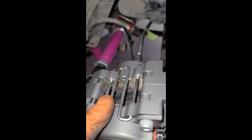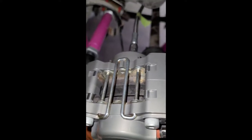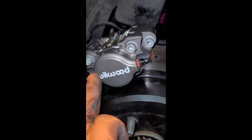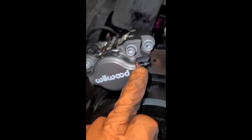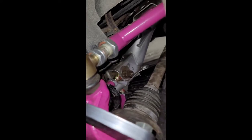The correct fittings were about three dollars for two at any hydraulic industrial store. Now you can see we have tons of play — nothing's holding — so that is all assembled. When you get this kit you're going to have bleeders on both sides. You always have to have the air at the top-side bleeder; plug the bottom ones. The feed is in the back of the piston — put the little stopper/bleeder there. So that's the hydraulic brake line routing.